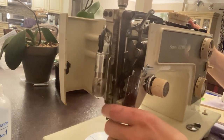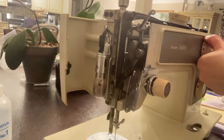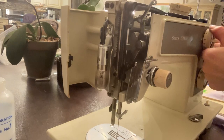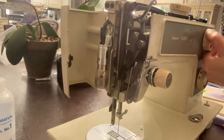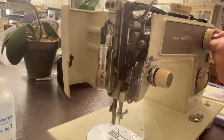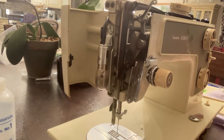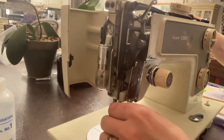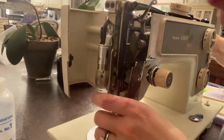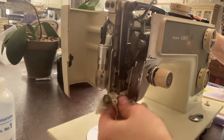This is how easy it should be to move — like this. Now when I rotate, when I change this, my needle is actually moving positions — you see that? That's glorious. So that's how easy it is to free up a needle when the machine is so clogged. You want to push it and be able to pop right back out. That also sometimes helps — just get a Q-tip in there and clean up any of the excess.